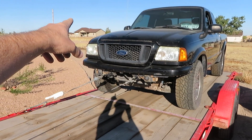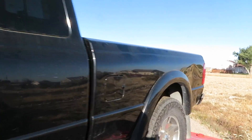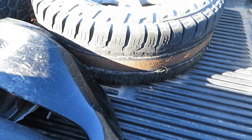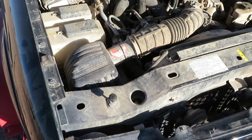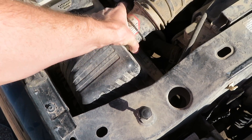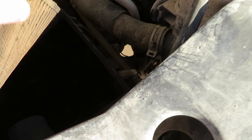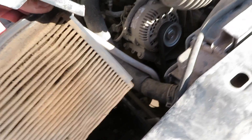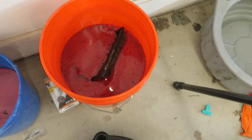What I'm going to do first is check the intake and then maybe pull the spark plugs. I was thinking about this on the way home — maybe what was going on was he was doing some burnouts, because look at this: these tires are almost brand new and just that one is all the way bald. So he was doing one-wheel peels and then hydro-locked. Let's pull the air box and see if water went through the engine. There's some mud and water in there — it got just a little bit hydro-locked, I bet.